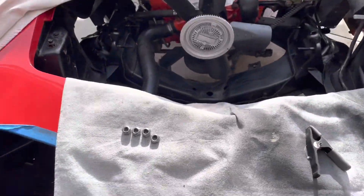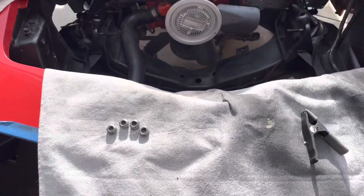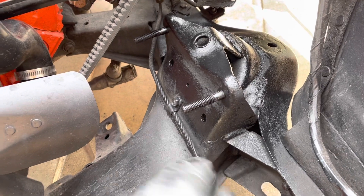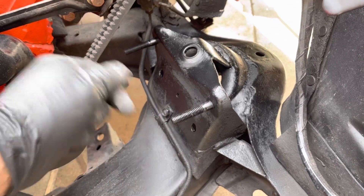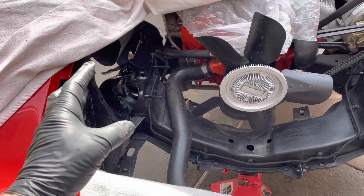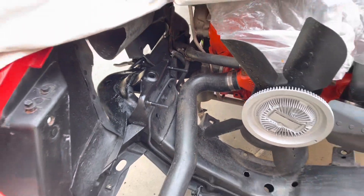I realize there's a little irony because I'm saving these original nuts while completely changing out the A-arms and suspension — I get it. I'm waiting for the paint to dry. I painted it and then hit it with a heat gun, which I highly recommend. It really makes a difference in how the paint sets up, the hardness and dryness. I'll call it an amateur tip since I'm not a pro.